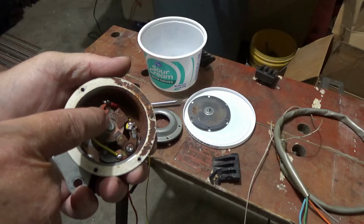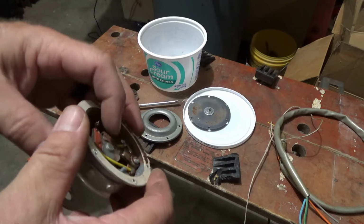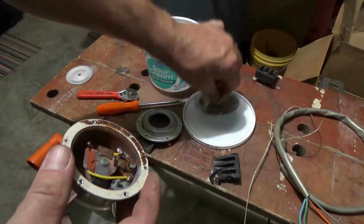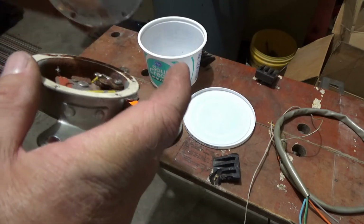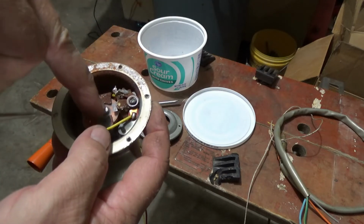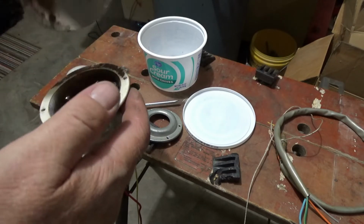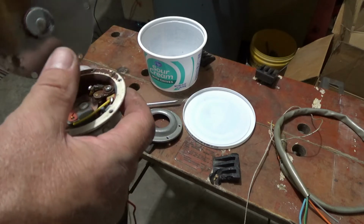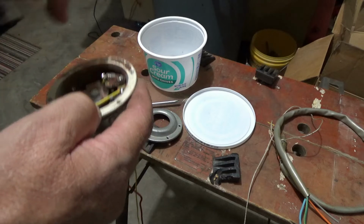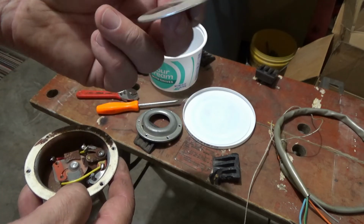And what this is, it's just a solenoid. There's a little breaker right here that breaks contact when this baffle button right here comes down and pushes it. So what happens is you put electricity to this coil, creates a magnet which pulls this pin down, and when it pulls it down, it pushes this against that tab and opens it up and breaks the circuit so it can pop up, and that flexes back and forth against this and it makes a buzzing noise.